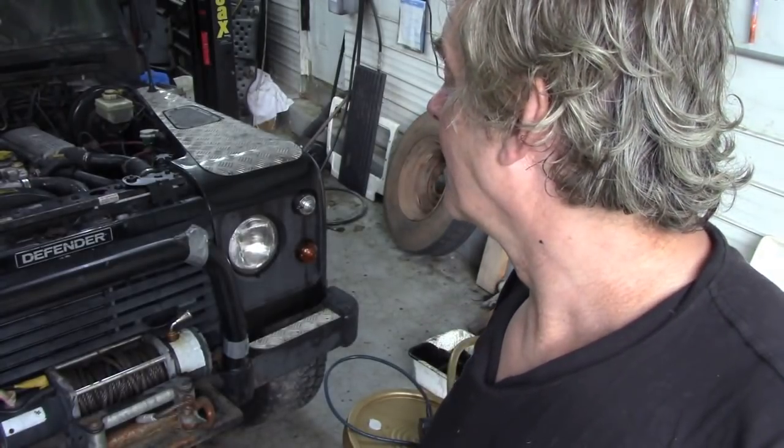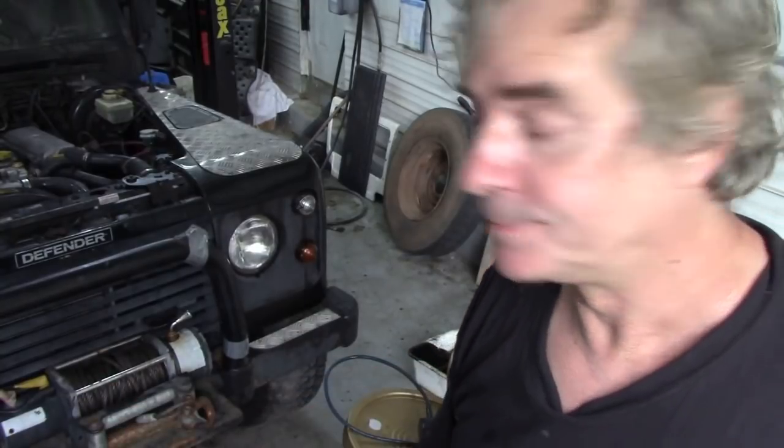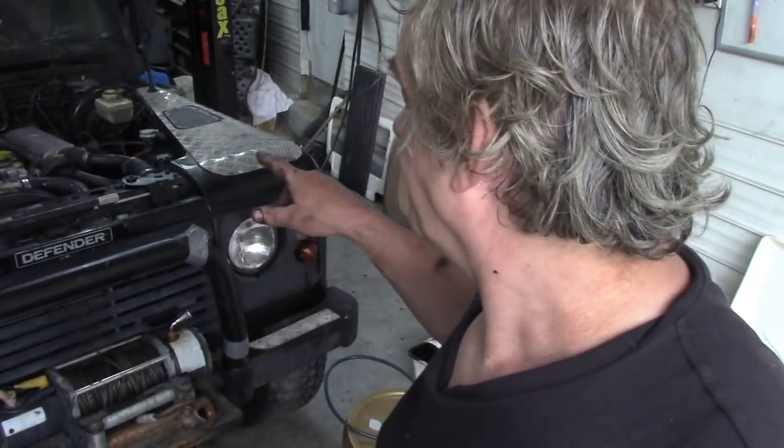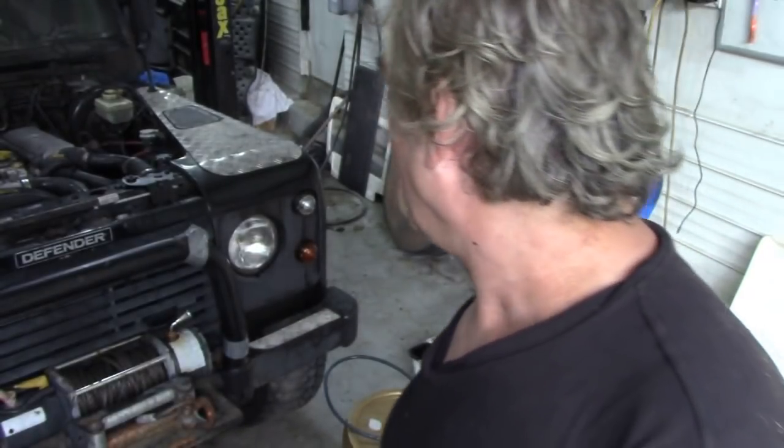I don't want to blank them off, because you want a little bit of circulation from the heat of the back of the engine to come round to the front. But I can't put that heat. So what's happening is this could be the problem why it's overheated again, because there was no circulation through the heater. If there's no circulation through the heater, that hot water at the back of the head has nowhere to go. Usually it runs back and gets sucked back into the bottom hose. I wonder if that was it. We will never know.